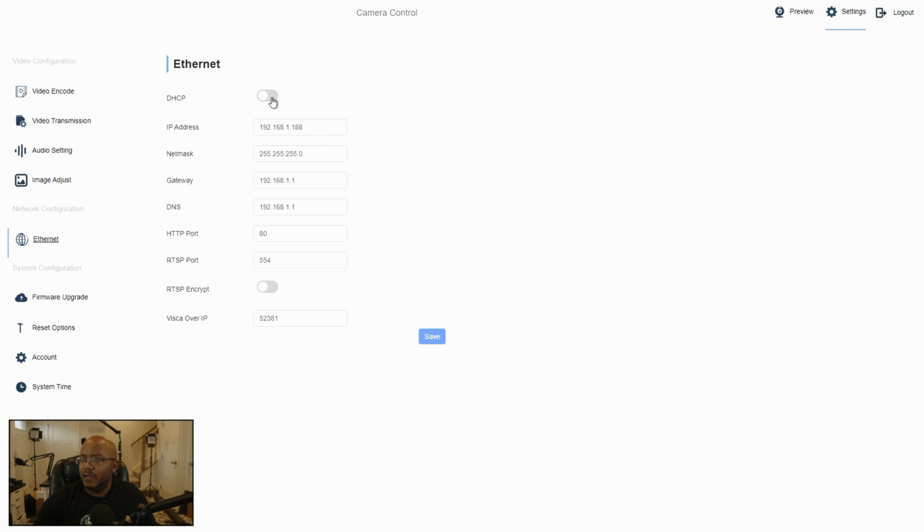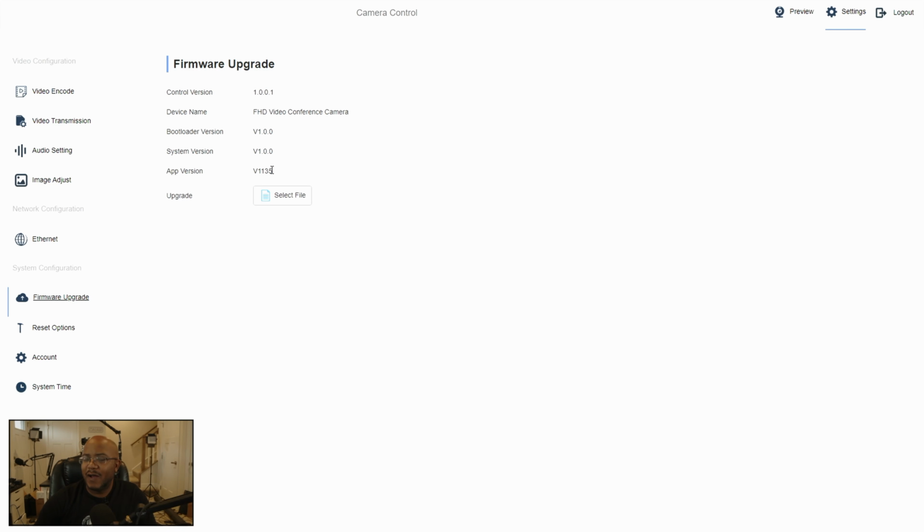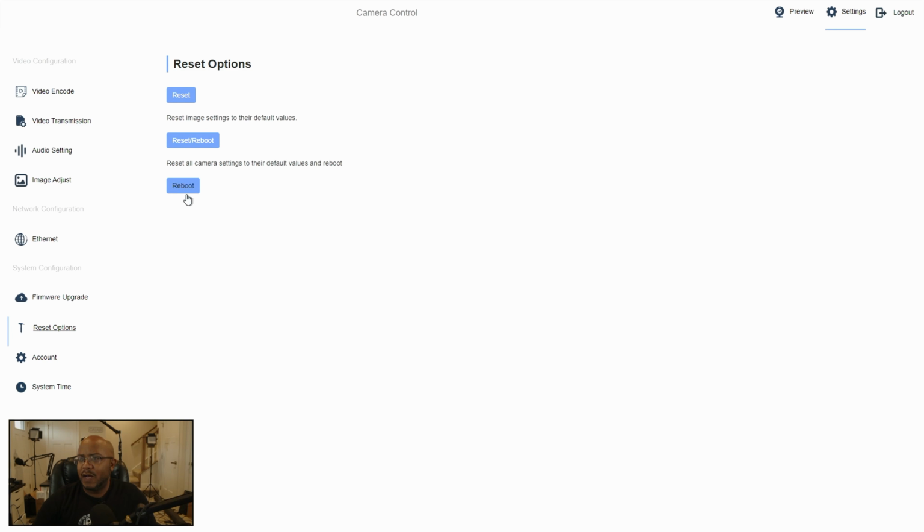All right, let's go to Ethernet. Let's put it to DHCP, RTSP encrypt, interesting. We do have our Visca, and I just turned on my controller here. Let's save that. Success, we did it. All right, we got a firmware update. So I don't know if a firmware is available, but I'm not going to go over that, but it's there. Reset options: reset the image settings, reset and reboot, and then there's just a regular reboot. I'm going to do that reboot to kick off the IP address change.